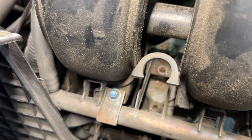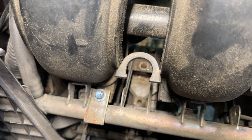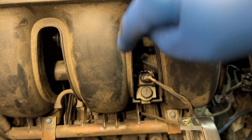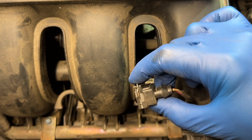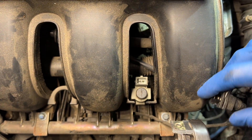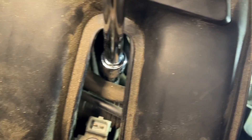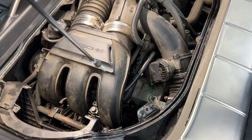You can see there is one more right down here. I'm going to remove this little clip — push this little metal piece in and it lifts right out. Right under that piece where the arrow is, there's one more. Come up through here and go straight down. To get this thing out, just use a magnetic tool and stick it straight down there and pull it straight out.